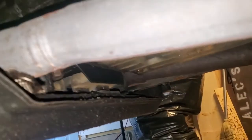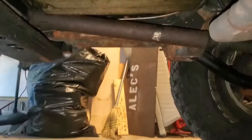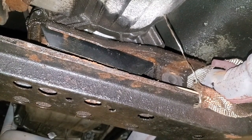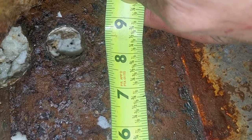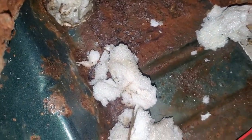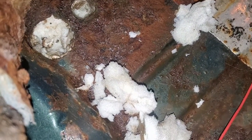As you can see here, you've got your mount. Now I'm going to show you how much my trans moves. That is not good. So you're going to want to go about 8 to 8 and a quarter inches off the sidewall, and just about hug that lip. I've got a lot of spray foam in there — that was a very stupid idea. I put spray foam in after I did the install, and I had to take the trans back out and dig through all that stuff. Don't do that.